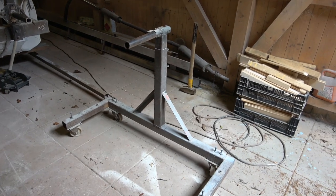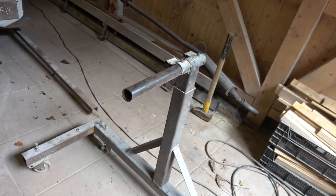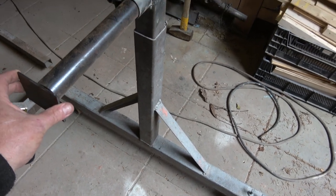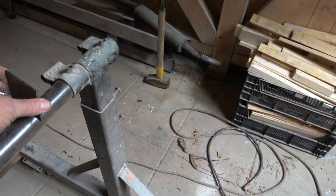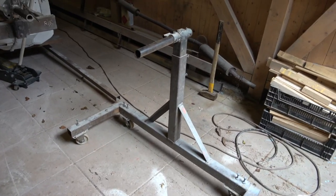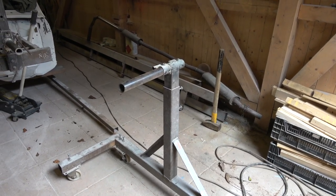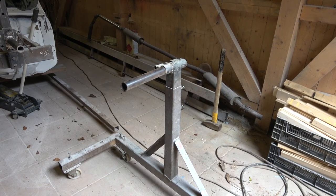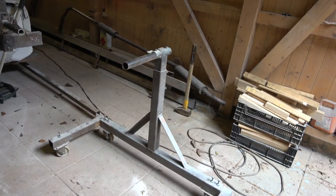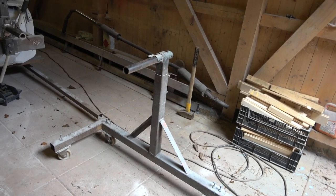That's the reason I've got this piece out. What I'm going to do now is make a new tubular with a flat plate on it - something a bit bigger than that but about that kind of thickness, maybe a bit thicker - which will fit in about here somewhere. And then this will attach to the side of the A-series engine where the oil filter housing is. This is how they're normally attached, and having these feet on it will make it nice and sturdy so we can spin the engine over, take the gearbox off first, and then strip the engine down.